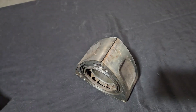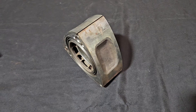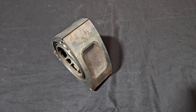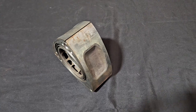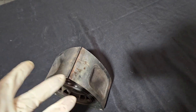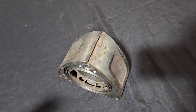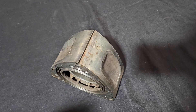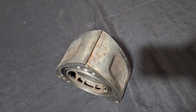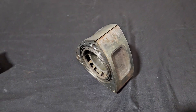Your modern rotors, your modern two millimeter seals, especially some of the aftermarket ones — extremely reliable. The OEM ones, extremely reliable. There's really no apex seal problem. Anybody can blow up a motor if you try hard enough, but that does not mean inherently that there is any type of apex seal failure, problem, or lifespan issue that we're really resolving at this point.